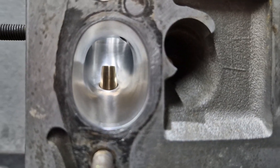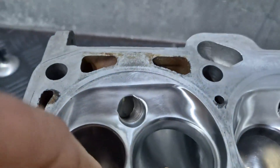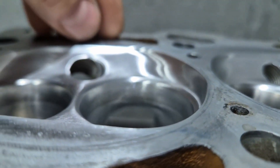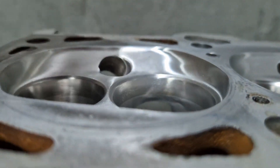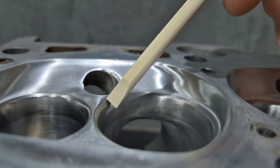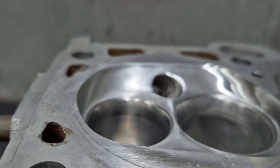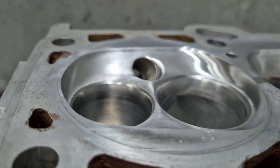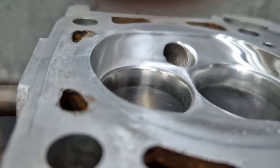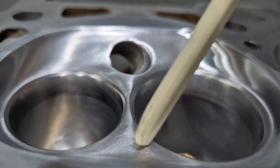There's your exhaust. We've worked on the short turn radii — get them nice and round. Remember that ugly short turn radius? We've got it as round and nice as we possibly could. We also increased the seats and got them to flow as good as we possibly can. Look at how the seats flow — it's a radius seat with a small seating area on top. Same on the exhaust. Remember those ugly corners in the combustion chamber — those ugly corners are all gone now. So the flow is much better.